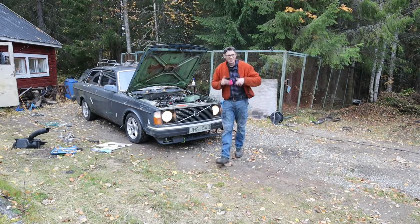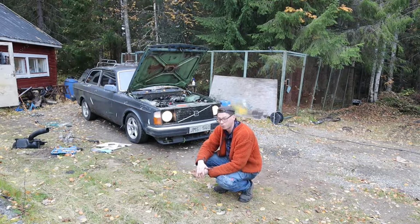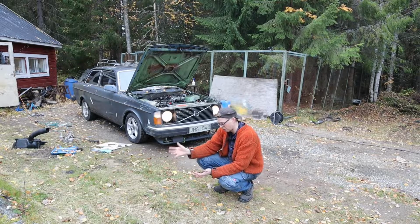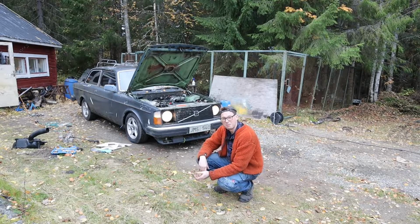It's breaking up really early, like at the 3 grand mark, and it did that before the turbo too, I would say. I thought it was because I was pretty conservative on the ignition timing. Under idle, like 8 degrees before top dead center, and when I revved it really high, up to like 25-26, I thought that was the safe end, but maybe it's a little bit too much on the safe side. So we're going to tweak the timing a little bit and try again.